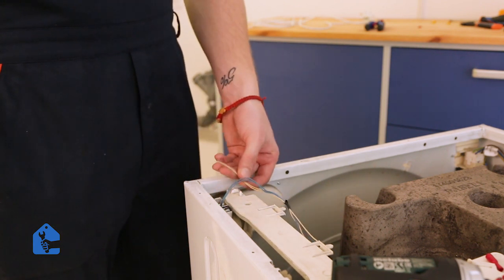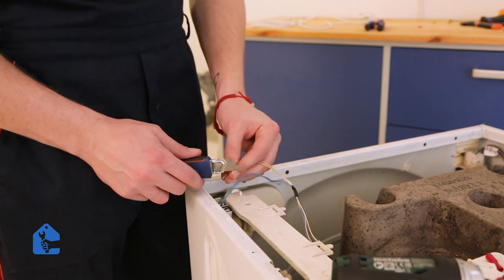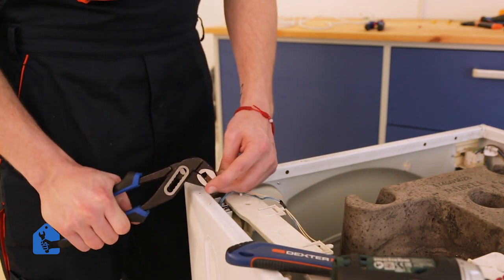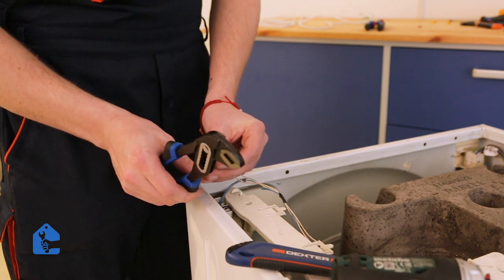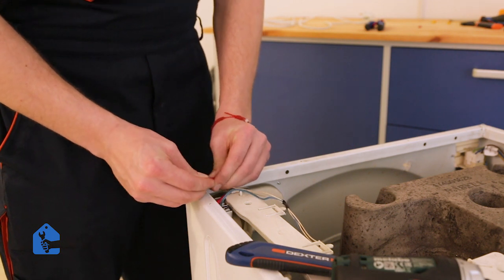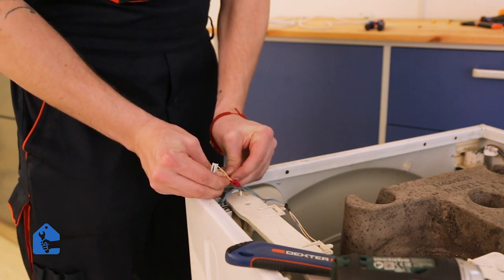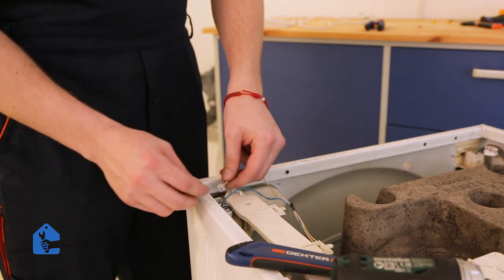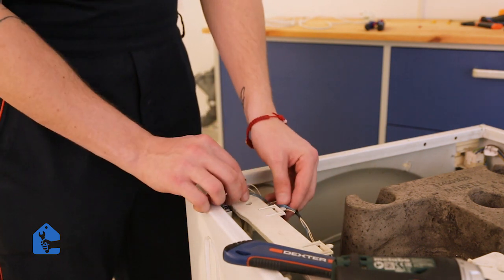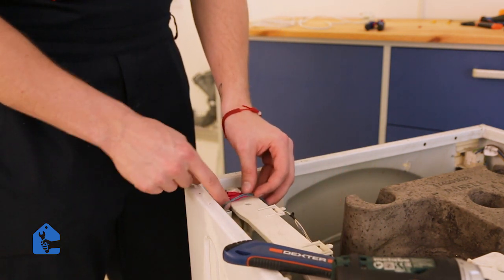Now all we have to do is work with the remaining 2 wires and connect the old harness block back in. Now clean off the rubber insulation from both wires, and I'm gonna connect the female connectors because our harness terminal block is using male connectors. Perfect, let's connect it back together. And connect the wire into the remaining valve. Perfect. Now let's keep our wire work clean and put everything back together the way it was.